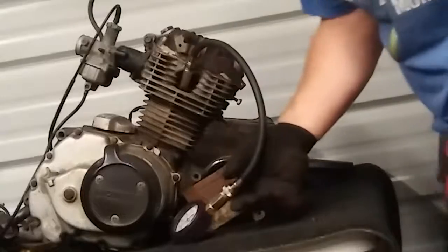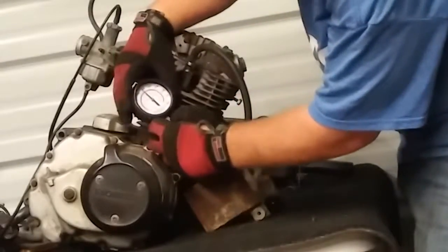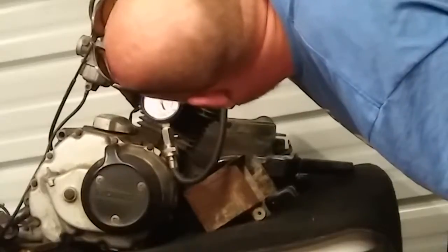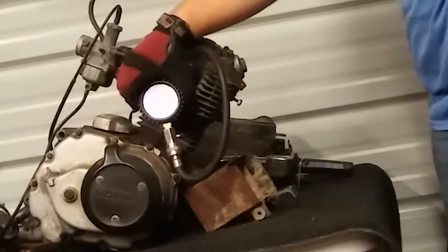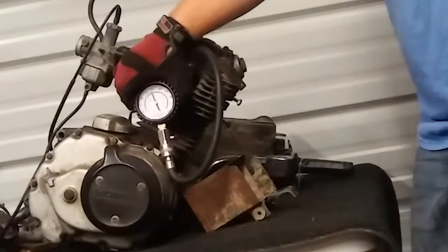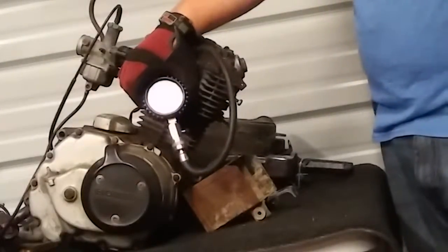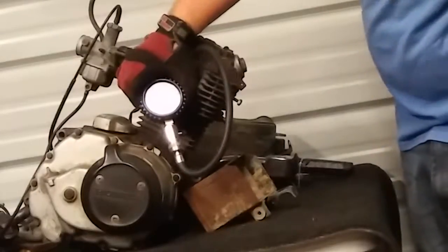Okay. Arm's still intact. I'm going to show you here what it looks like. We've got just a tinch over the 140 mark. That's pretty stinking good compression. You can put a little bit of fuel to this thing, maybe add some spark to the mix. You've got to run an engine.